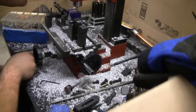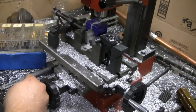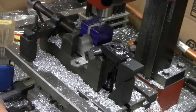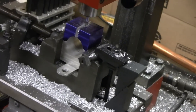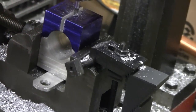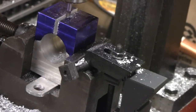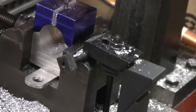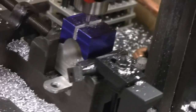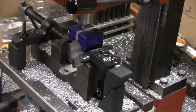You're just about finished on that, huh, Mike? Yeah, just about. What are you doing now? I am cutting a notch — well, a slot — because the distributor is going to be held in here and there's going to be a bolt running through here to pinch it in place. Just doing a final pass on that. That's going to be pretty nice. It's a shame we won't be able to see it behind a shroud. We'll know.